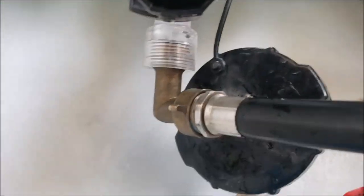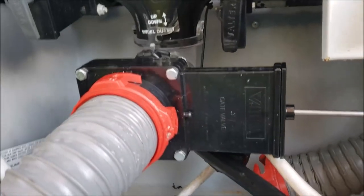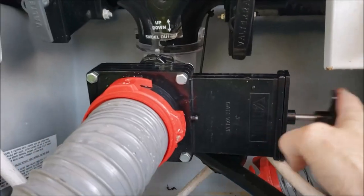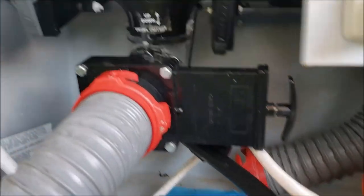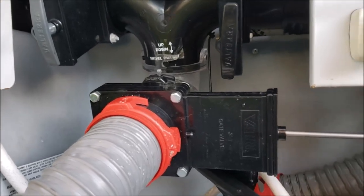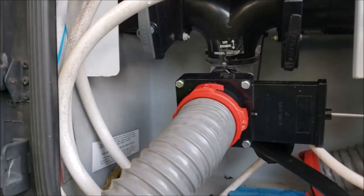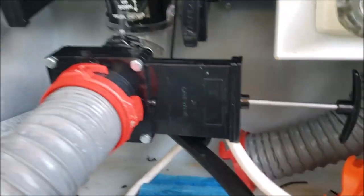I've got the hose hooked up right there. Now I'm going to open this up — you want to make sure the water has somewhere to go, because if you have the valves closed off and you kick on 55 psi, something's going to break. So I'll open this up, go turn on the water spigot, let the flow start coming down the hose, then open and close these valves to see how quickly the tanks fill up.